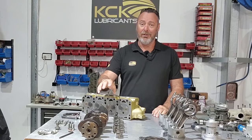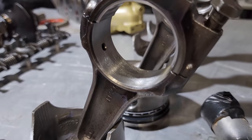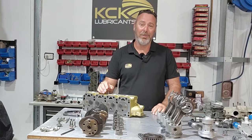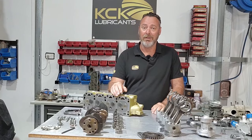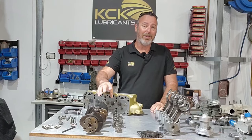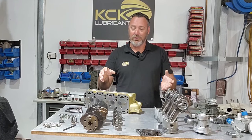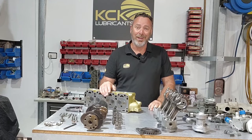We've got a standard crankshaft that doesn't really belong in this engine and a discoloured conrod. When we pulled the dry sump tank out in one of the previous episodes it had a bunch of shrapnel on it, so this thing obviously spun a bearing at some stage, really hurt the conrod and destroyed the crankshaft. This crankshaft is straight out of a road car - it hasn't been balanced or lightened and really doesn't belong in this engine. It's just been patched up to get it running again.